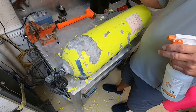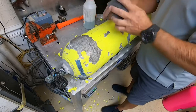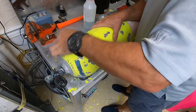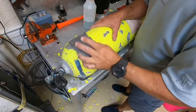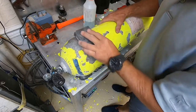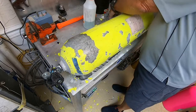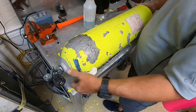I don't want to scrape too hard with the razor, so I use a sanding sponge. I wet it, I wet the tank, and I do a light sanding — all I'm doing is removing oxidation. I'm not going after removing aluminum; that's not my target. Then I'll take a paper towel or a rag and wipe it clean.